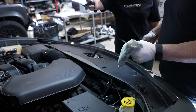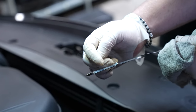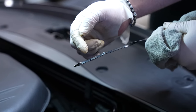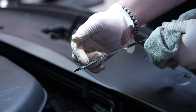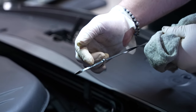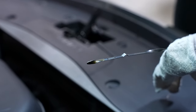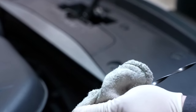When the dipstick is clean, you can see there are two holes. The lower hole is your minimum oil level and the higher hole is your max. You don't want to overfill it, and you don't want to run below it. The distance between the lower hole and the top hole is one quart — so if you're on the bottom hole you can add one quart and be completely full. Let's take a look where we're at. We're right at the bottom, so we can put the rest of that quart in safely.